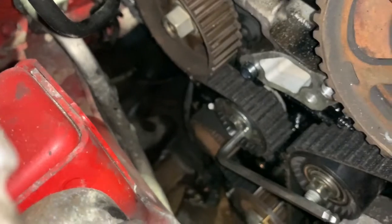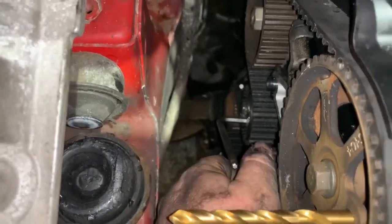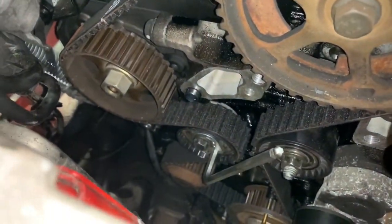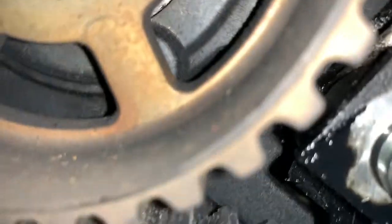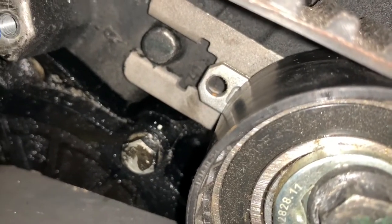So now what you've got to do is tension it with one hand and pull the peg out with the other. Now, obviously I'm holding the camera, so I can't do that. So let me just stop this a mo. Got him, press the button. I've done that. Now, it is very difficult to see that pointer, which I showed you earlier. So don't take the Allen key out yet, but I'm going to use this camera to help me see the pointer. Now look, it's bang on in the center. That's exactly where it needs to be.